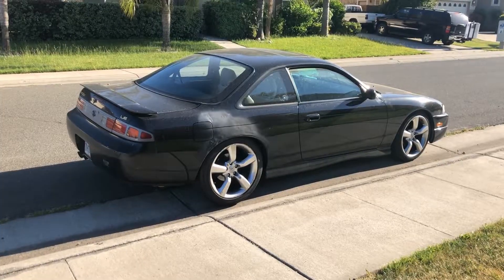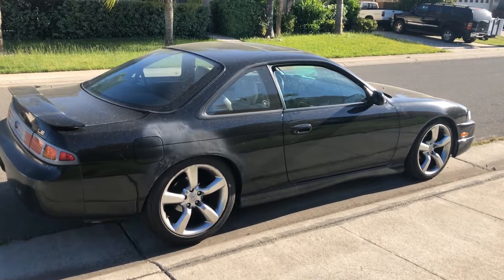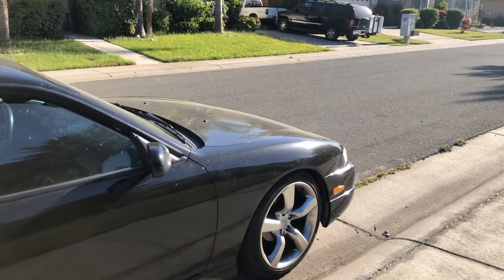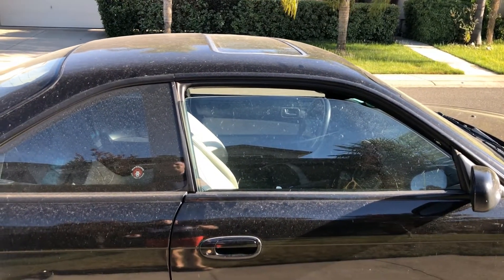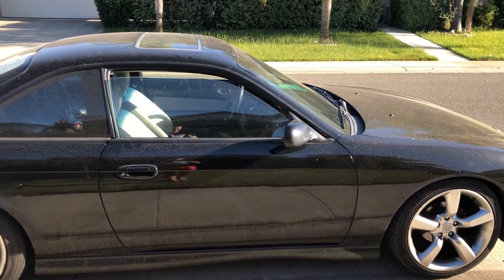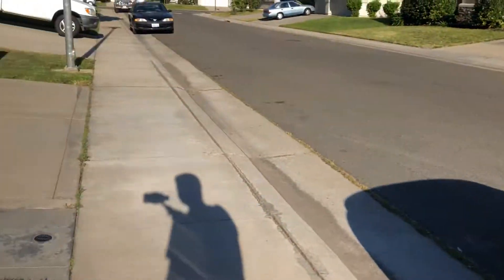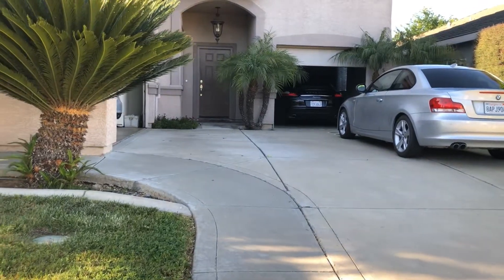Today I'll be showing you how to do a simple quick AC performance test. Step number one: the test prefers that you have a fan in front of your vehicle, which simulates air flowing through as if you're driving. Don't do this test inside a garage or enclosed area — perform it outside. My car has been sitting in the sun all day and it's black, so I'm going to pull it up to the shaded driveway outside and run the test.